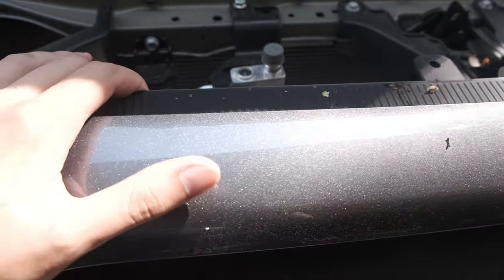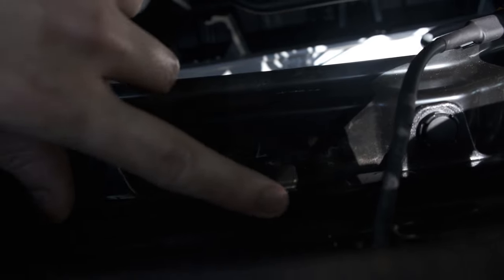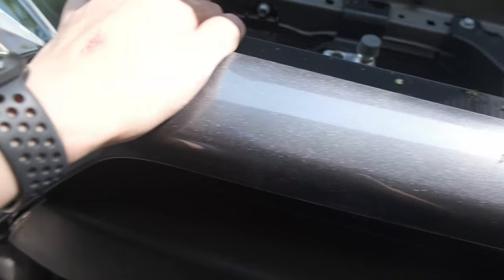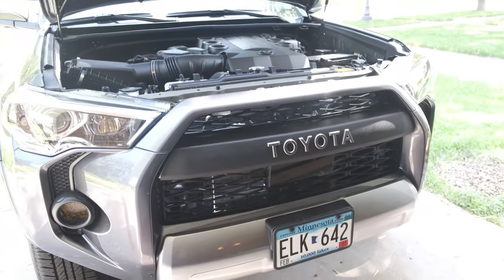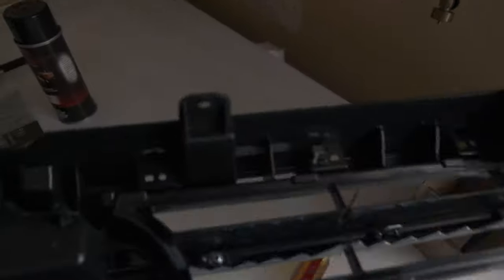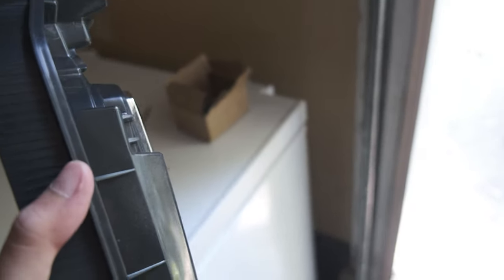The first time I took it off, it did take some elbow grease. Keep in mind there are some tabs here that are connected to your OEM top grill as well. You can either press this in or just yank it out and it should pop right off. Once you've taken your top valence piece off, it's going to come with the top grill. To separate it, undo the screws — there's one here, one here, two here, and the same on the other side. Grab a screwdriver and unscrew those. There's a rubber seal here which makes it kind of hard to take off, so I used a pry tool and just pried it apart.